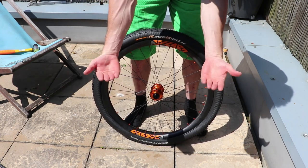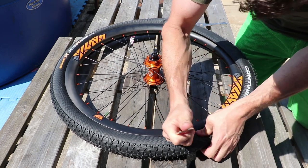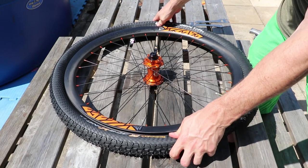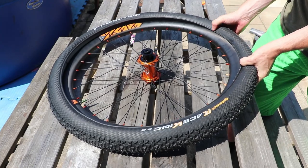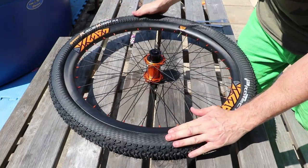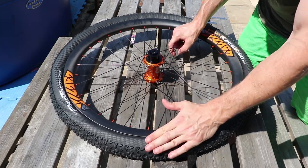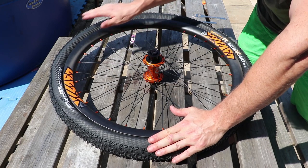It can often be a bit easier to do this if the wheel is lying flat rather than vertically. Once you find the bead getting quite tight, one tip is to get a tire lever and just try and push the bead of the tire into the dip in the middle of the wheel — this should hopefully give you enough slack to get the tire into place. After a bit of manhandling, trying to get that tire well and truly into the dip, that's the first side on. Now it's simply a case of swapping this over and doing the same on this side, forcing the tire into the middle of the rim to give you as much slack as possible. A lot of people going tubeless will leave the tire off the rim in a small section to get the sealant in, but fitting the tire completely is the best way for this situation.